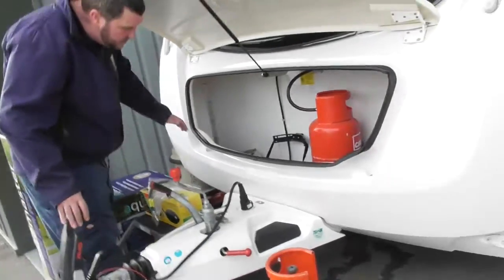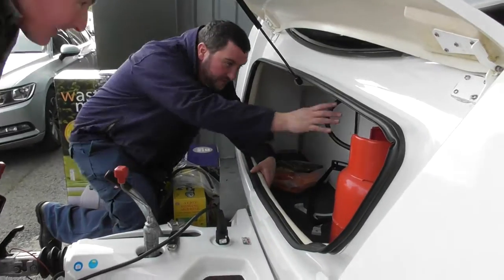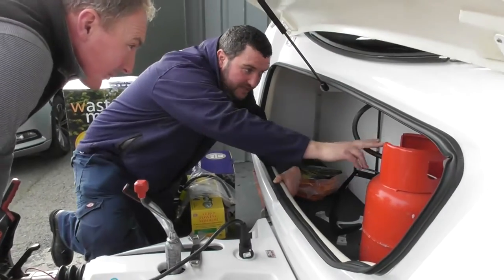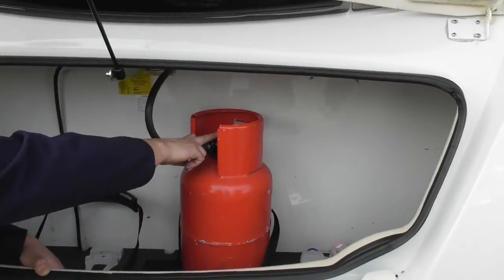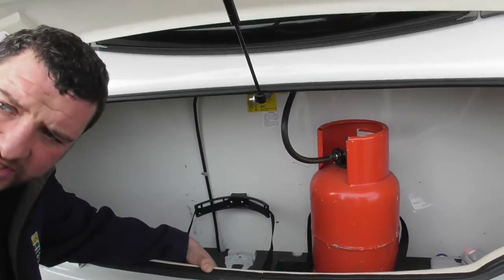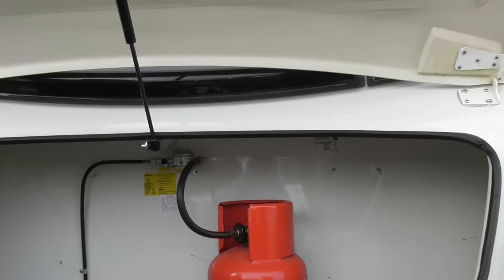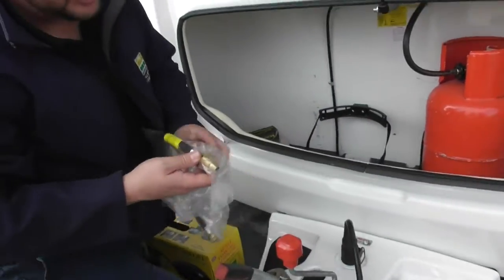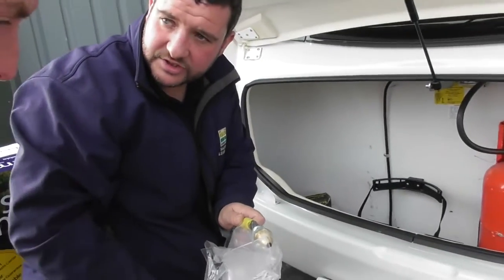Moving into your gas locker on the front — I've put my demonstration bottle on here but at the end I'll fit your appliances so it'll be ready to go. Gas bottle on and off is just from the bottle. There's an open and close on the bottle, so just make sure you open the bottle all the way up. When you're finished or you're travelling, make sure you've closed the bottle down. There's a regulator on the back and a gas shut-off valve, but that's more for when the guys do a safety check on your van. Really for gas on and off just switch your bottles on and off. Your gas bottle just needs a gas spanner — it's an opposite thread, so screw it on and hand-tighten it to make sure it's nice and tight.